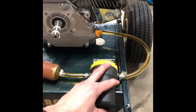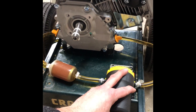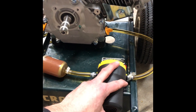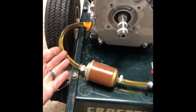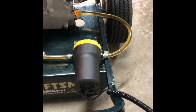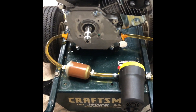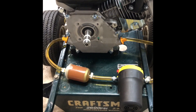Quick note: I just flipped the pump on — hooked up to an old car battery — and it really pumps. It's going to be turning the pan over a lot faster than the 0.2 liters per minute stated on the box. The pump is rated to run at a 5-amp load for up to 30 minutes, so I'm going to try this just a couple of minutes at a time to make sure I don't burn it out, and if it looks okay then let it run a bit longer.